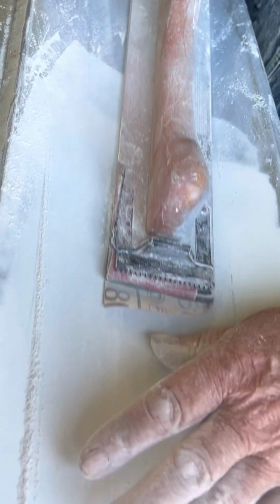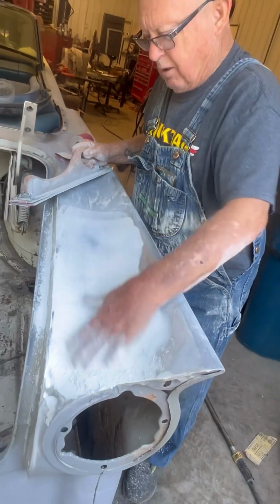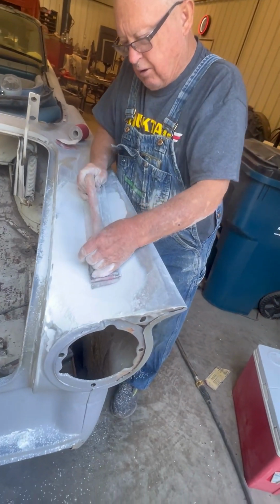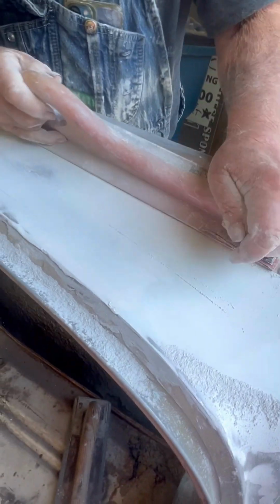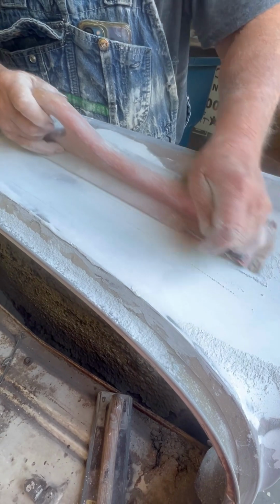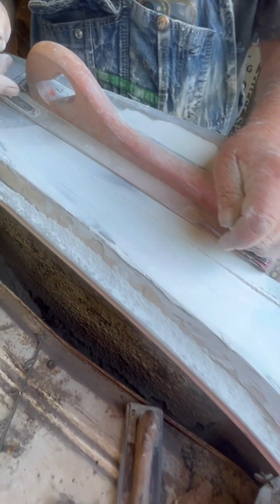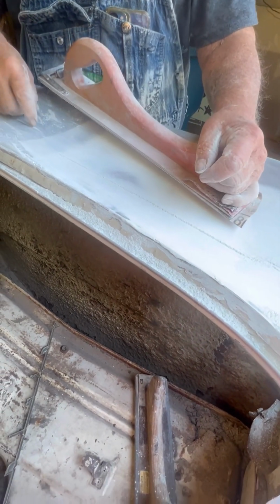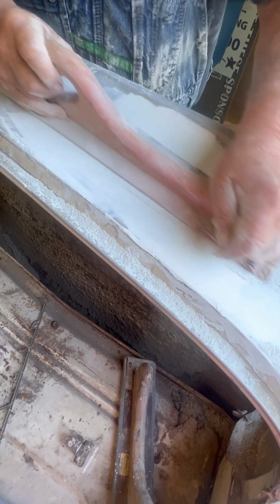Is that because there's less to sand down there? No, because this is higher than this is, and I'm just kind of scrubbing over the top of this and sanding this. So every once in a while, you get all that stuff off of there, and then you start your little line again. I start it from clear up here. See how it's lighter there? Now, see, we're getting farther back, but we're still not back to here yet. That means this is still higher than this is, see? So you just keep working that until you get it all even? Yep.